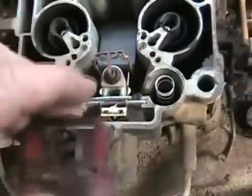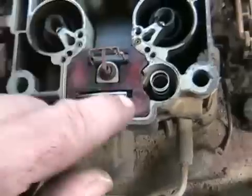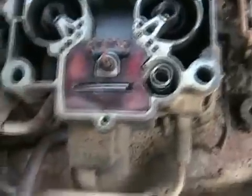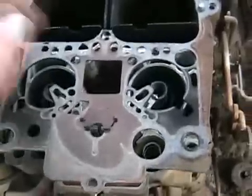On top of this little float shaft and the power valve goes this little plastic block to hold everything in place. I've just cheated and bent the gasket back — it's not that important because the fuel doesn't come up that high; it sits about right there. Every time you set a float, you set it so that when it shuts off the needle valve, it's exactly level with the top of the carburetor for all machines. Tuck the gasket back under the power valve.